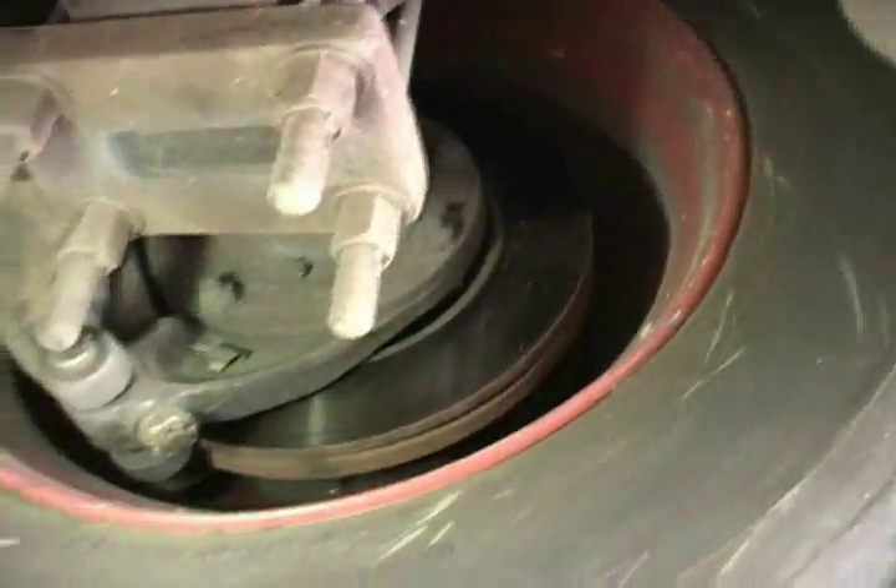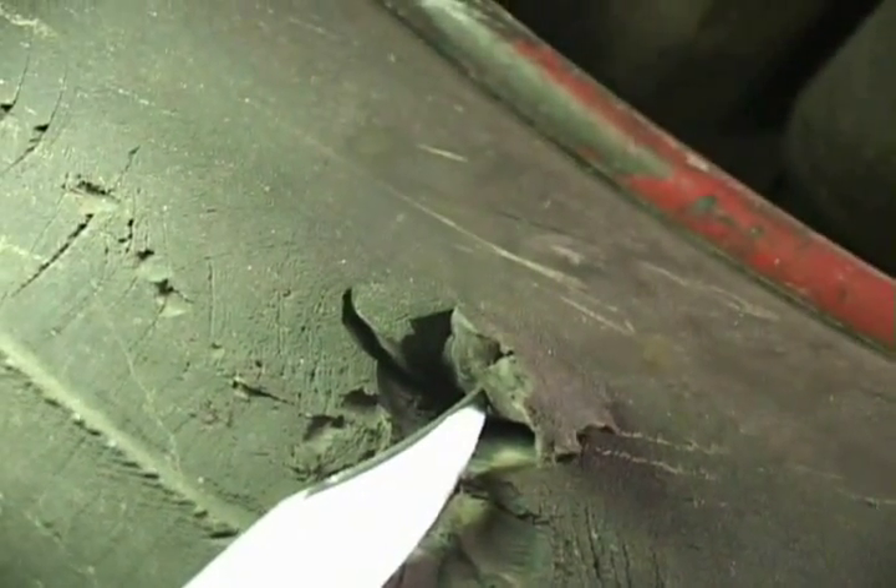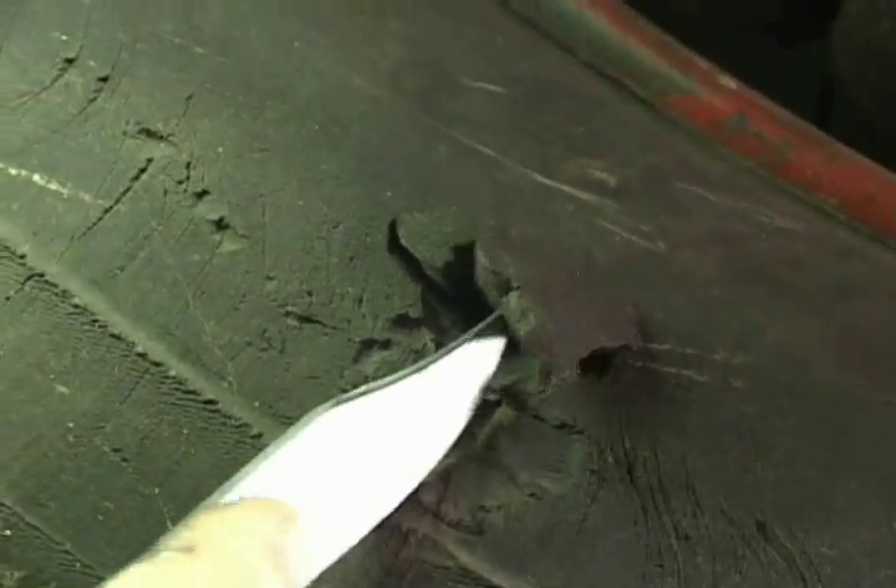You can also take a look at the condition of the wheel here and look at the inside of the wheel. There is some damage to the inside of this wheel that needs to be investigated by the mechanic. Take a look at this tire — see that gouge? See how deep that is? This damage to the tire that I just discovered will probably render this tire unserviceable, but I'm going to have the mechanic look at it right after we're done filming here.